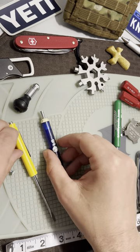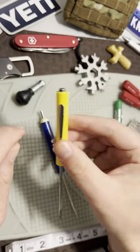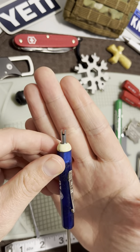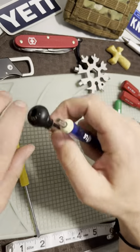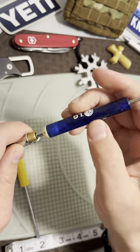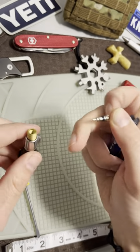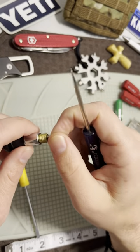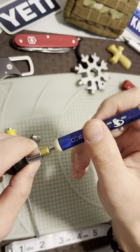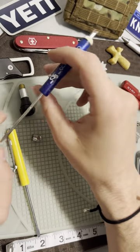The yellow and the red are the same, so let's talk about the two most common variations of pocket screwdrivers — almost always flathead and almost always with a magnet. This one, which ironically is made by LG, is a flathead screwdriver but it also has something on the end. Does anybody know what that is? It's a valve stem core remover. You stick it in here and take the core out of the valve stem just like that. When you go to a mechanic shop and they work on your tires, they use this to let the air out or remove the valve stem. A lot of mechanics use these little pocket screwdrivers. Even if your tire is low and they can't find the leak, you can check and make sure the valve stem cores are tight — it's rare they come loose, but it's possible.